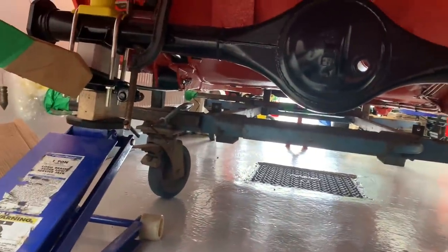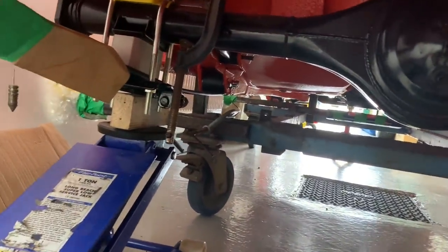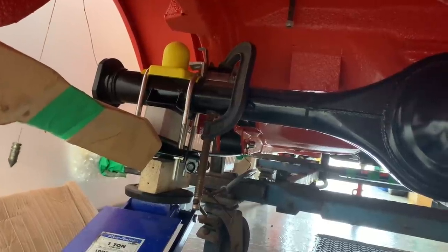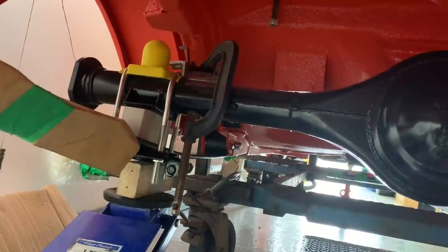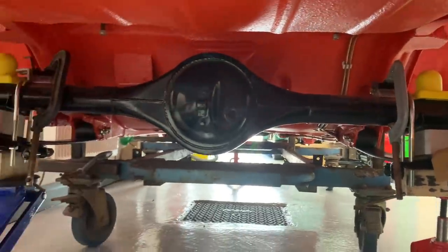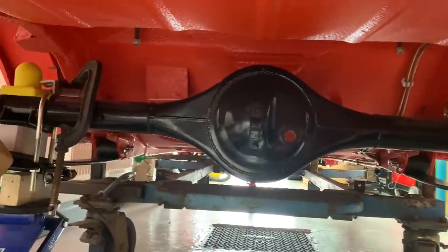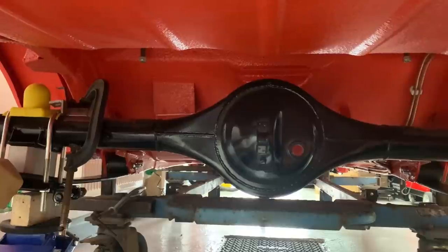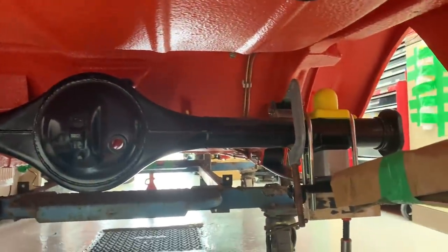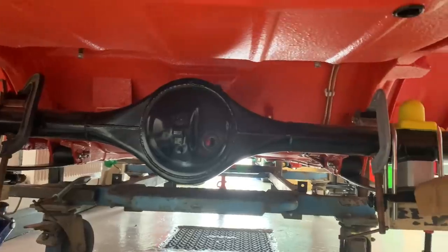We're jacked up. I've taken just enough weight so the wheels on the frame have just left the ground by a couple of millimetres and no more. I've jammed some bits of steel in to hold the top passenger side anti-roll bar in the right place, now more or less equal to the driver's side within a mil or so. They're now clamped in place and ready to tack. I absolutely hate tacking underneath a car — ever since a red hot spark went right down my ear hole while welding, burning all the way to the bottom. I had earache for days, so I now sometimes wear earmuffs when welding underneath.